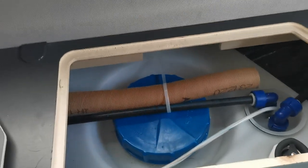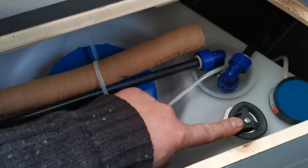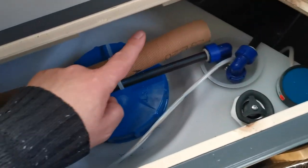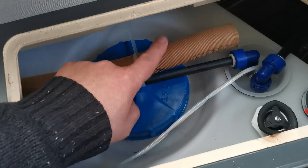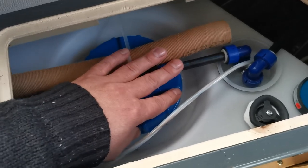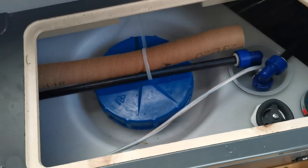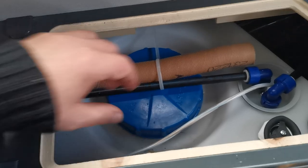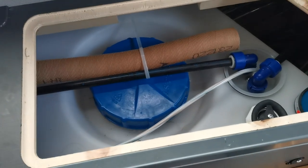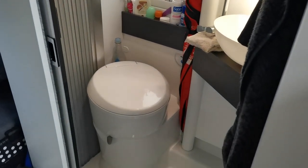The last thing in the back is the water container. You can fill it from outside like any other van. There's a black rotary valve to open and dump all the water when needed. The pipe here connects to the heating system - turning the valve under the passenger seat blows warm air down here to stop the pipes freezing. If you can't get a hose connected, you can unscrew the lid and fill directly into the container - quite a handy tip.